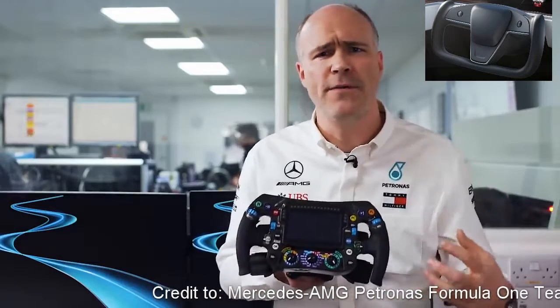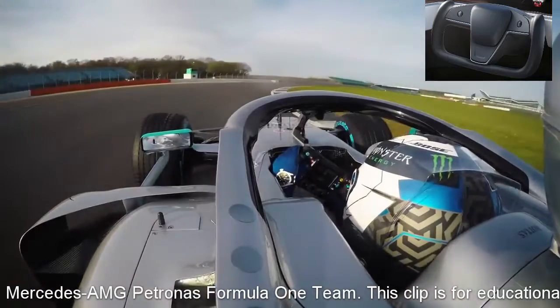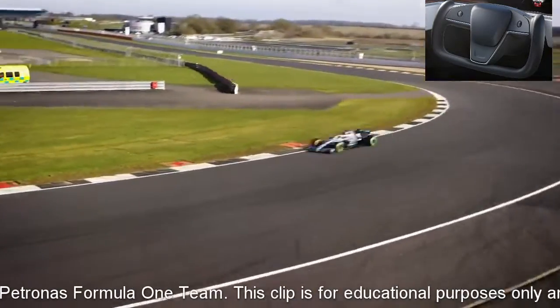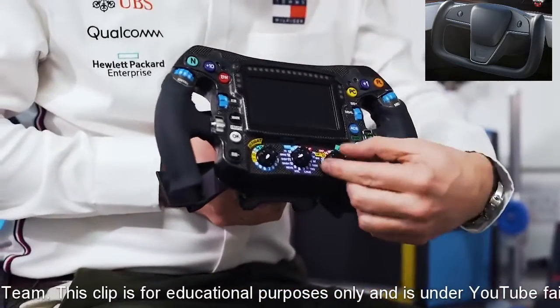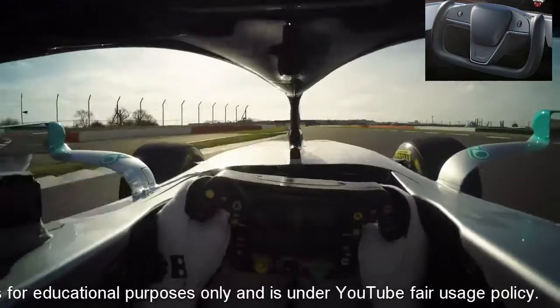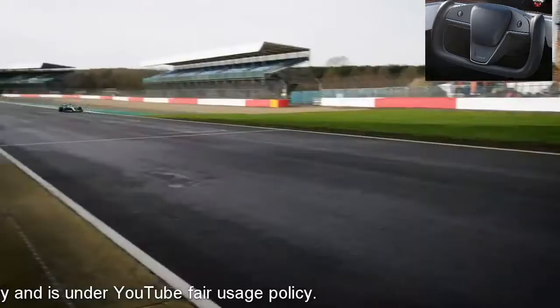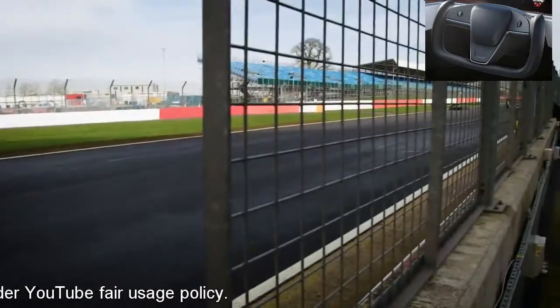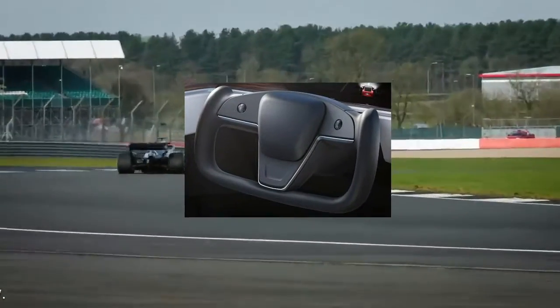The drivers are involved right from the very first stages of the design of the steering wheel for a new car or for a new season. That involves everything from the physical shape of the wheel, the layout of the buttons, and also the interaction with all the complex systems on board. Their input is critical. The wheel is designed around switches that are quite robust, used in aircraft as well — robust against accidental actions under vibration, as the driver uses it in a high-vibration environment wearing gloves. Designed around first-order retrievability: the idea that the driver can get to anything he needs while keeping his hands on the wheel and reaching with his thumbs.